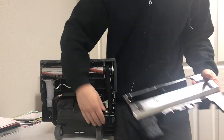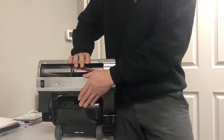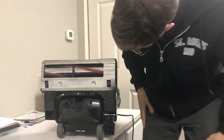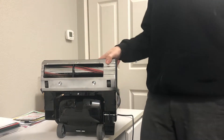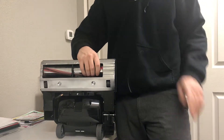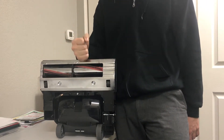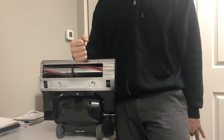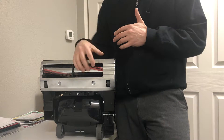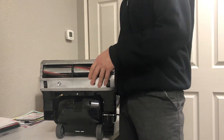We've got wheels on the bottom plate and on the back. This particular unit — this Riccar — is called a floating head. It has an automatic setting, so the wheels are at a fixed setting all the time. That's okay for mid-pile to low-pile carpet, but once you go into thick or plush carpets, recommend vacuums with height adjustment. If a customer tells you they have really deep plush carpet and their vacuum doesn't have height adjustment — like a Dyson or others without it — that's probably why they're having problems with the roller or cleaner head not working.